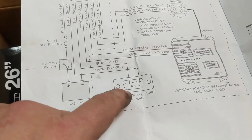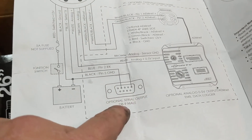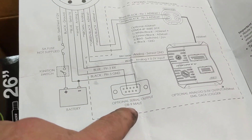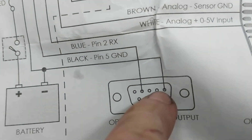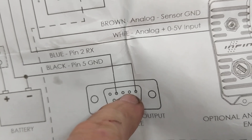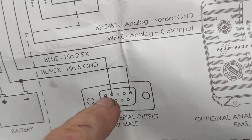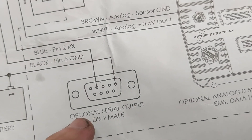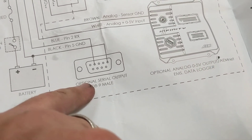I got a cheap one on Amazon, then got a USB-to-serial cable that was male — meaning it has the protruding pins — and it went to USB. It didn't work. What I finally realized is that pin 2 on the male side actually poked into the port at the center of my finger, which is really pin 4. So the pin 2 that the male USB connector was expecting is really pin 4 on my adapter. Essentially, if you get an adapter like I got, the pin numbers don't matter — you've just got to trace it through and do continuity testing with a multimeter to make sure the real pin 2 and pin 5 signals are getting through.